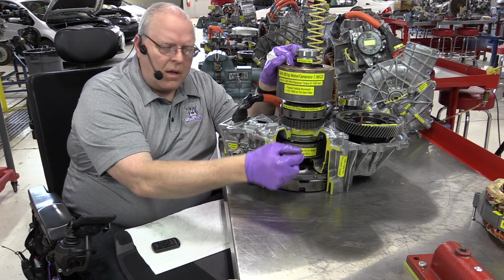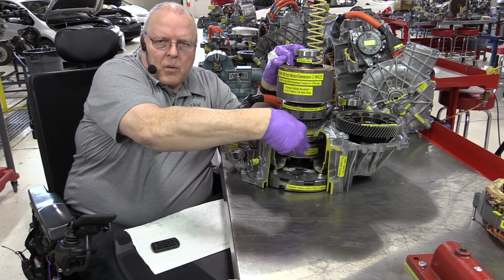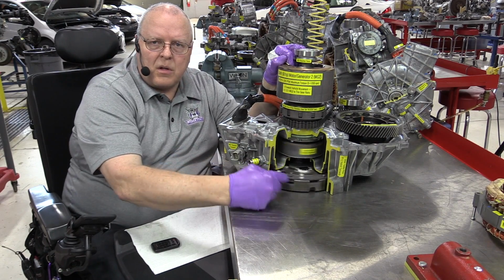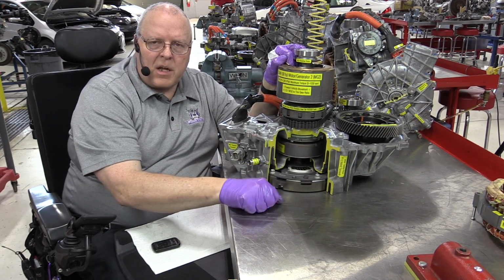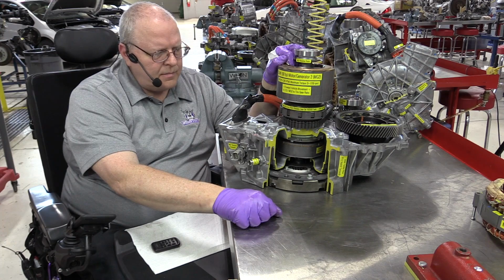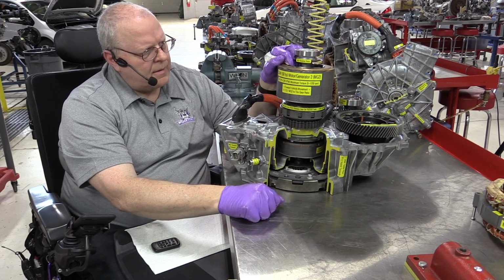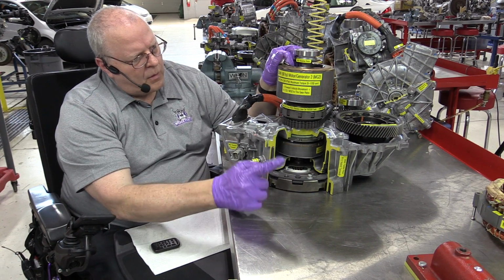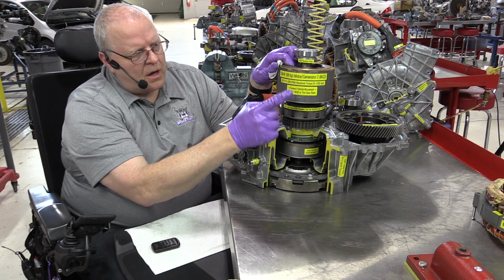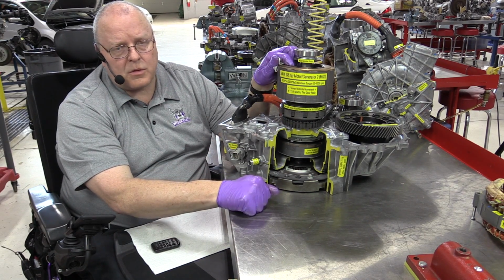MG1 is both the starter motor. Notice if I rotate MG1, it causes the flywheel here to rotate. And when the engine is running, the flywheel turns MG1 and makes it be a generator. And it's got a 2.6 to 1 gear ratio there to cause that to rotate faster than the engine. We have, as we mentioned before, 50 kilowatts of power, 68 horsepower, 400 newton meters of torque, which is 295 foot-pounds of torque, which is pretty impressive.